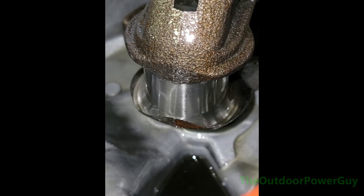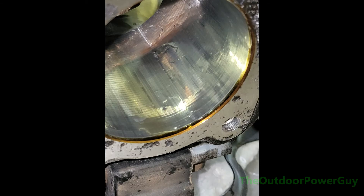Here is a picture of the crankshaft journal — there is just a little bit of aluminum transfer, very little, you could feel it with your fingers. So if the crankshaft journal is basically in pristine condition with only a little aluminum transfer, what caused all the damage? This is the cylinder, which caused the damage to the motor and caused it to fail. The cylinder was not bored correctly in manufacturing, and damage resulted due to the coating in these cylinders — this does not have a cast iron sleeve. There is severe damage to the cylinder, which caused the failure. The damage was about midway through the motor. This was an interesting failure.